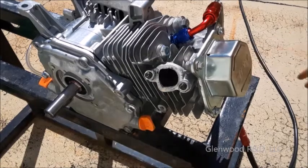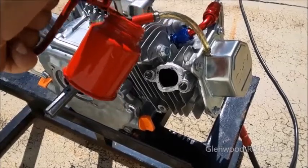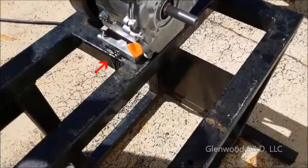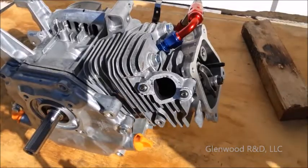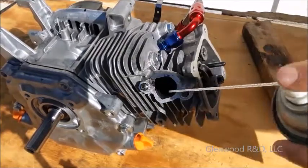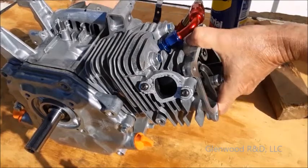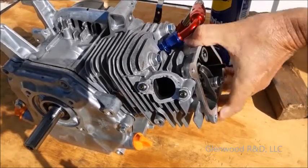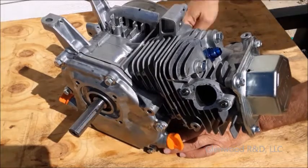Let's run the engine and oil it. Note the used oil draining — it can be captured and redirected with a hose. When you stop your engine, even for a few minutes, add a large dose of water-displacing oil into the cylinder through the exhaust port and rotate the engine a few times. Otherwise, it will seize. Now fully assemble the engine using all the crankcase bolts. If it spins freely, you're ready for steam.